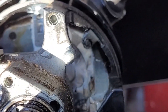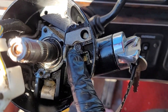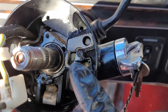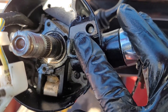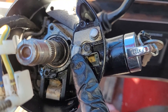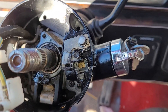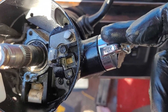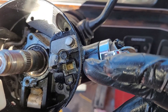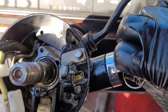Let me assemble this and bring it back. When you put this back in, that brass gear is keyed, so it has to be rotated a certain way to fit. It also has to fit on the sliding piece, which is also toothed. These three pieces all have to be aligned — you'll know when they are because the tumbler key will fit perfectly, and you'll be able to pop the key in right away.